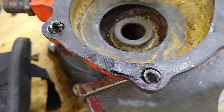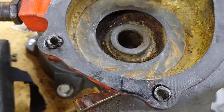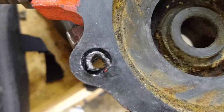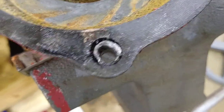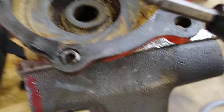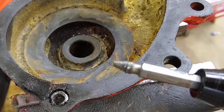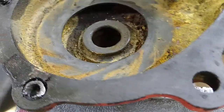I finally got those bolts to start loosening up. I soaked them, hit them with heat — nothing really worked. So what I did was drill a hole straight through both of them. I tried using the bit extractors, which are pretty good, but they assume the bolt isn't frozen in there.